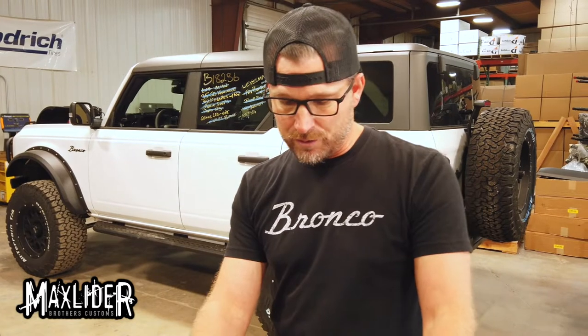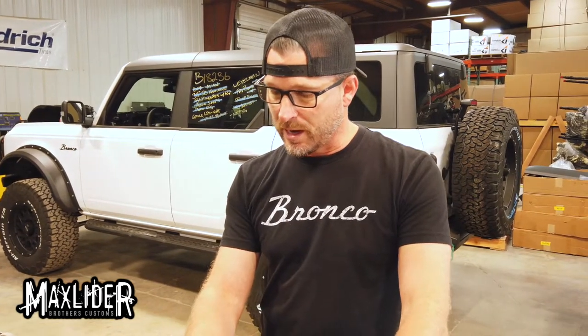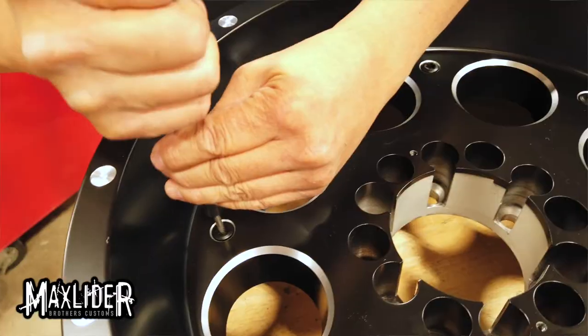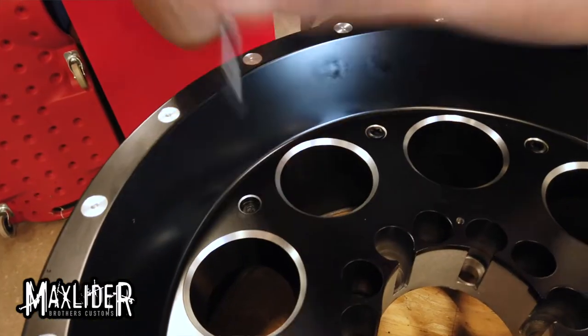What I'm hearing is we have to either find a new wheel or figure out how to get those out and then replace them safely. A couple ideas — we will have to damage them to get them out. We can lightly thread that and put an Allen plug in there, or get some hardware that's about that size that we can thread in there after they powder coat it.